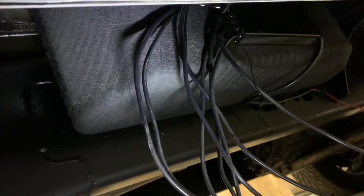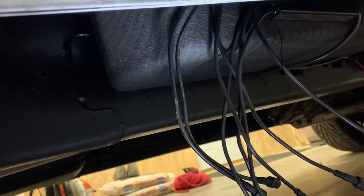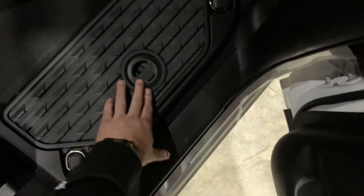I'm on the passenger side of my vehicle, and this is where I found it best to mount the controller. I went with the passenger side only because I was going to be screwing into the RAM box — the batteries on these trucks are on the driver's side, so I hesitated to mount it there. I figured if I'm ever going to use the RAM boxes I'll probably use the driver's side one more. In the end it worked out well — I got some flat head screws and mounted these flush inside the RAM bin. The liner still fits and your WeatherTech cover goes right over it.